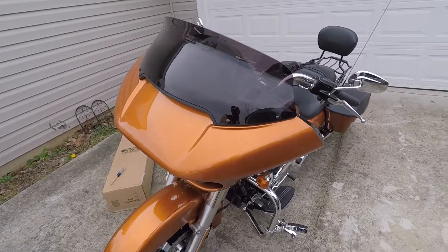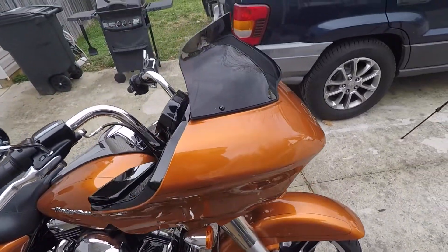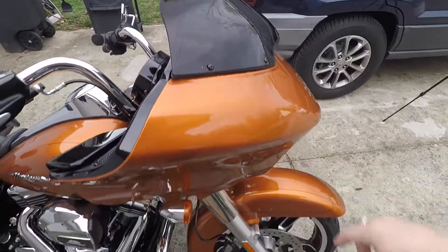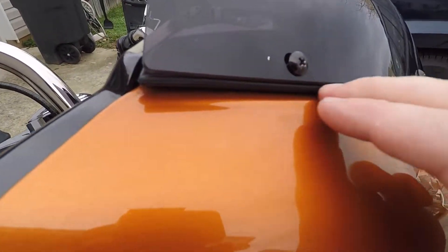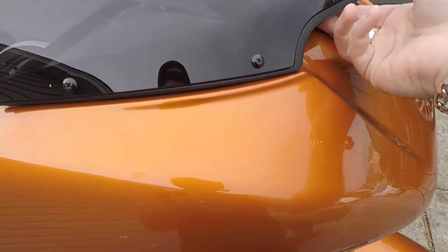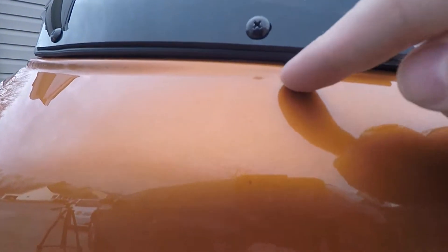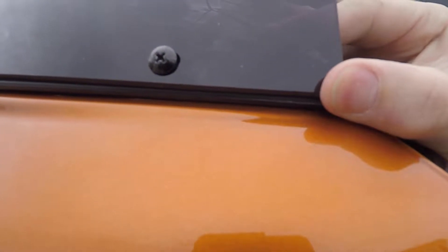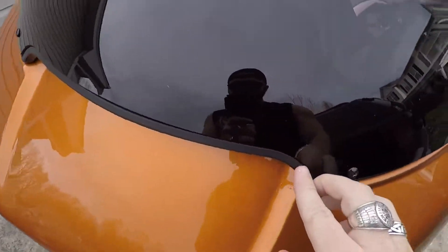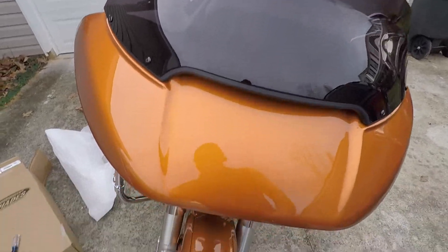Oh yes, now look at that. Got the other windshield laying there on the ground — definitely went on in one step. Man, the difference on that lip — check that out. Now, another thing you probably saw in the quick speed-up is I was having some issues with the edge of my gasket right there that goes in between the windshield and your vent. Just take your time. I actually did have to back this screw out a couple times. A lot of people, what they don't know is they'll go in here and start prying at things — they'll slip and chip their paint. This is rubber; it's really soft, so definitely don't pry on it. You've got a little bit of room to push down on it here and lift up on your windshield to slowly tighten these. Just go around and make sure that your gasket is seated all the way. It's going to take some time after some heat and sunshine to conform to it perfectly. But overall, I think she looks great.